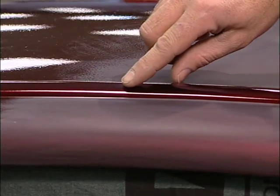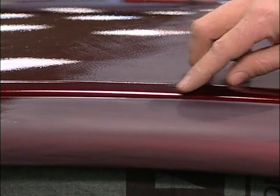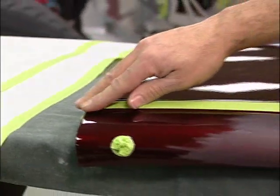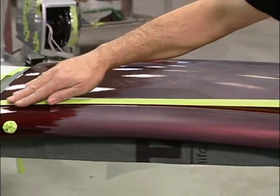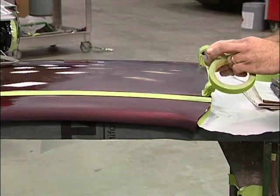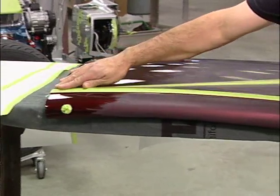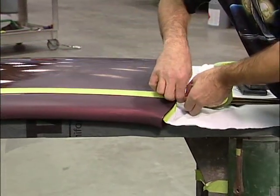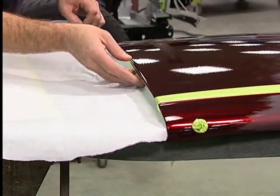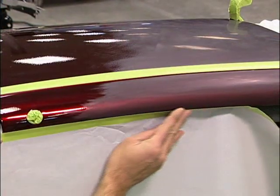The first thing I'm going to do is mask off the reveal, which is right here. It's a line that is used on the early 30s cars, and I don't want to color sand that with 1,000 grit, which is what I start my color sanding with. I will sand it with 1,500 grit in the second step. So we completely mask it off to protect it. We put the paper on here to protect any jams so that the residue from the color sanding doesn't make a mess of the rest of the door, and it's also left on while we buff the paint.